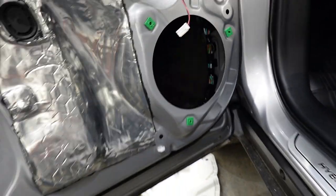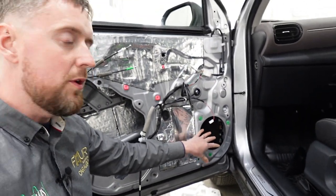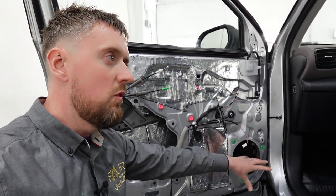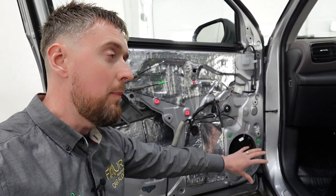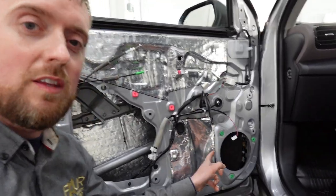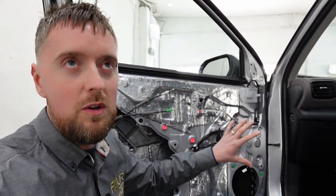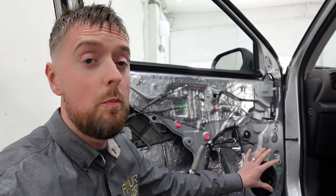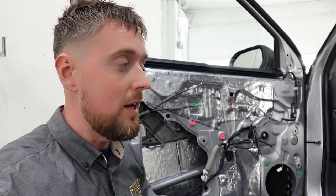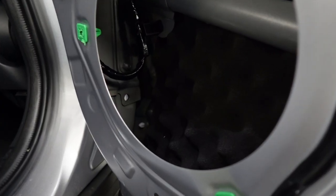What we also do is through the speaker hole here — this is the factory speaker — on every speaker upgrade we put a wave diffuser behind the speaker itself, which reduces standing waves and basically helps with the mid-bass. It's really important material. We've done it on the factory speaker this time because we thought: why have we got it apart, why not make the standard speaker sound better? Even though he's not doing this for an audio upgrade, it will be a by-product — the soundproofing will make the speaker sound better. If we zoom in you can just about see the eggshell material.